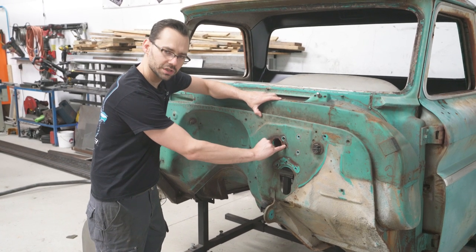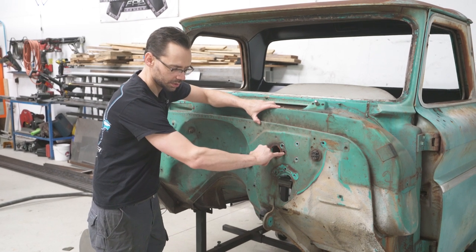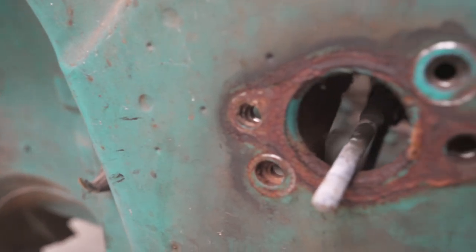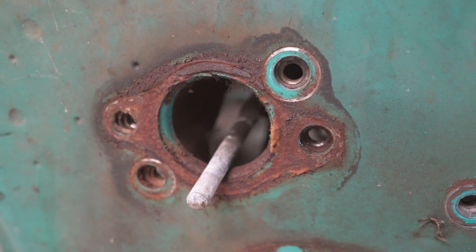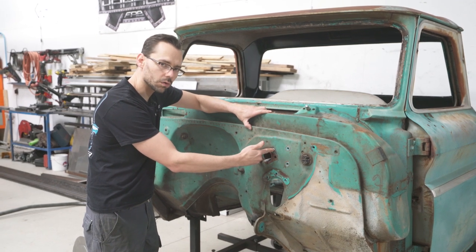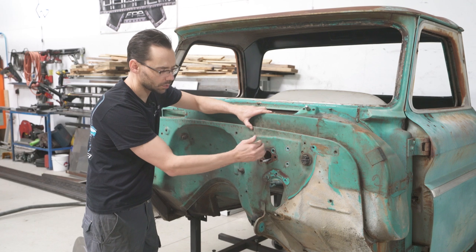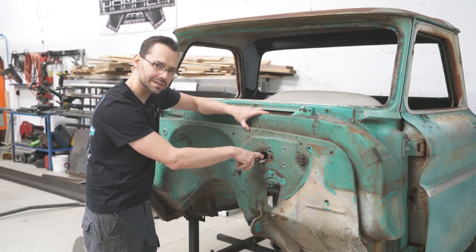So a couple of bolts here we need to keep. We need to keep these two, the horizontal bolts, because those fit a standard master cylinder, even aftermarket stuff. And then it'll end up having a push rod coming through there like that again. We do not need the two diagonal holes at this point. So all that's gonna get chopped off anyways, but right behind the firewall here is a bracket.